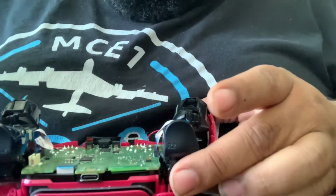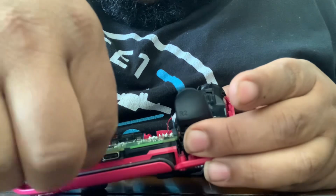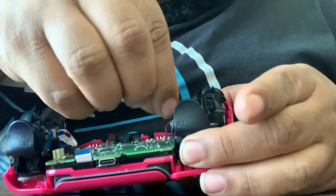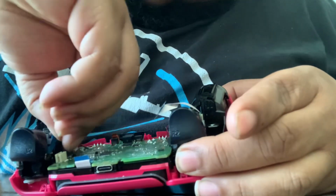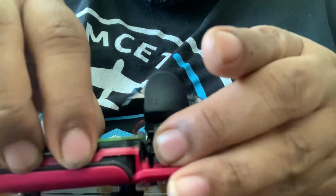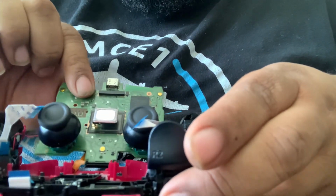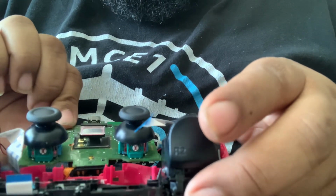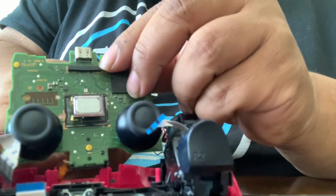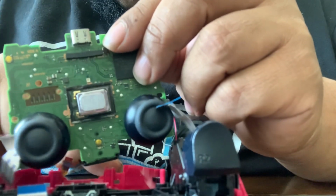And you lift this out, and you basically do the same thing for this blue tab here, blue tab over here. Disconnect all of these. Disconnect. Disconnect those, and then you take this, wiggle it, and just pop it up. Popping those two, and then you pop this up. You want to be careful when you flip it over that you don't mess up any of the solders. I also forgot to tell you to detach the other sensor that was on there. That's what I just did, this one that's sticking up here. But you flip it over nice like that.